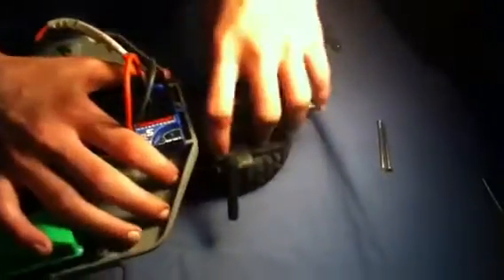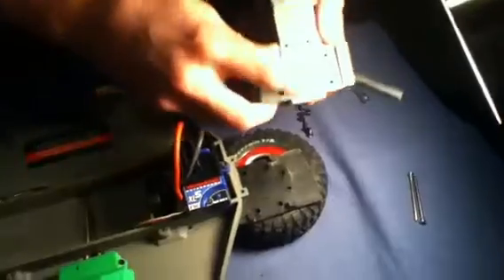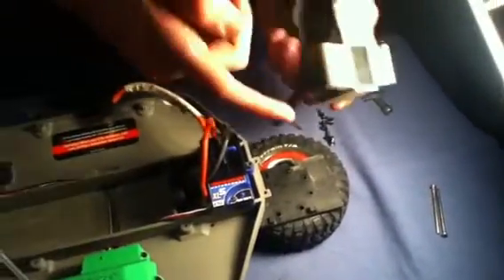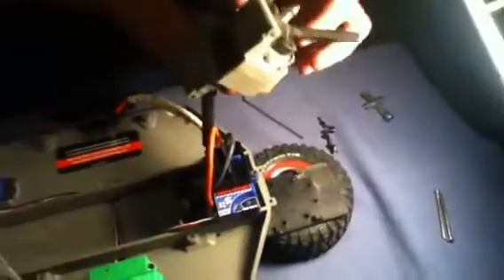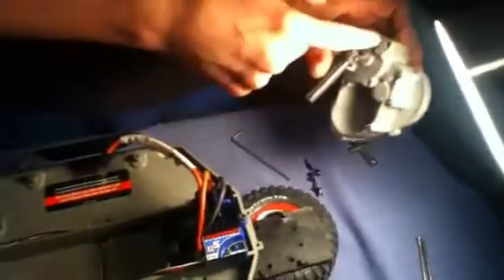I got those six screws out. This is actually a little hard sometimes — you just pull up and out. On the bottom there's electrical tape. I'm not sure if you can put regular tape on there, but I put electric tape back on there because that's what was on there — better safe than sorry. There are six screws total: four are the 2.5 and one, the smallest, goes right here — make sure when you put that back in the smallest screw goes right there.